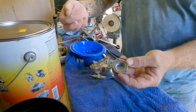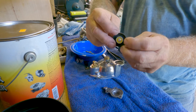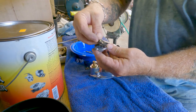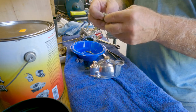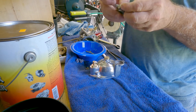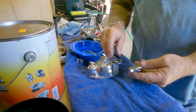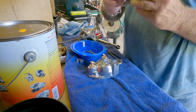Now this is the fun part, the hard part, the easy part. Right here there's a groove, and on this diaphragm there's a groove — little brim right there. That brim fits into this groove. So that spring goes there, this goes down there, fits into that groove. Push it in that groove, make sure it's in that groove — because that's really groovy. It's under pressure because there's a spring there. You want to make sure it's all pressed down. You have to slide it down there and hope that everything stayed and didn't move around. All right, take two — pain in the butt.